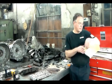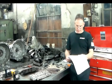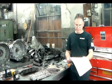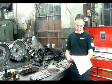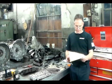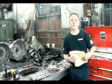There were some codes present. I had codes in the trans controller: 56BF clutch gears 1, 2, 3, 4 neutral test; 56BD gears 2nd and 6th neutral test; and I also had a 56C5 shift valve B stuck in off position.